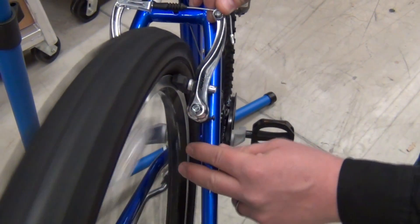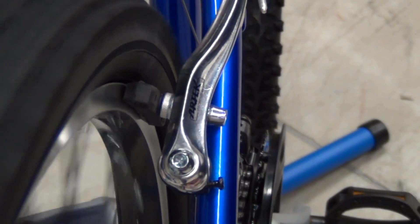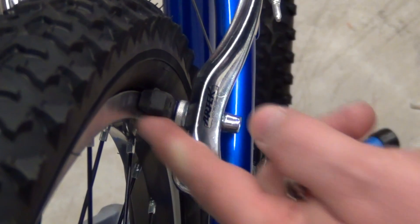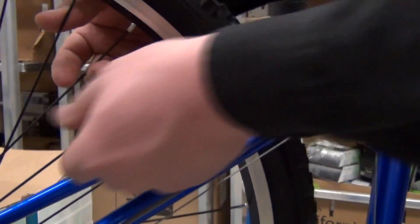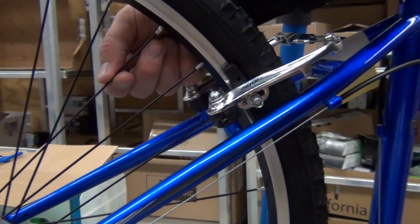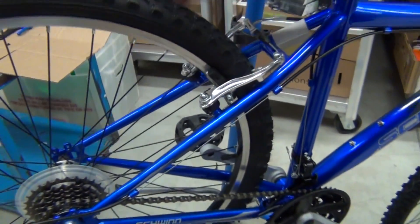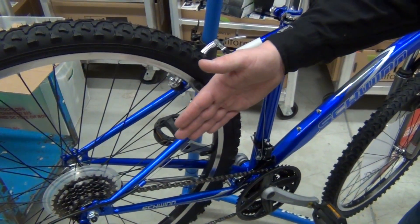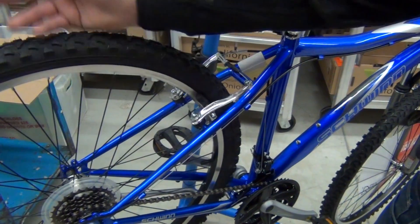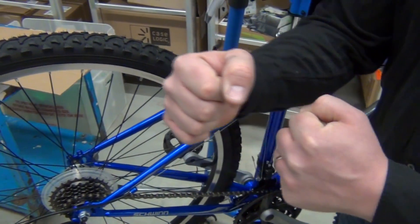If I move my brake pad, I can actually use that as a stop. There's one particular spot that comes close and actually hits the brake pad. Here is the spot - we have spokes that go to both sides. We're always going to work in sets of three when it comes to a wheel true, dealing with the left and right side. At this particular spot, the rim was off to one side, so I need to loosen this side of the wheel and tighten the other side. The wheel true is a perpetual give and take of the two sides.